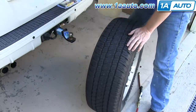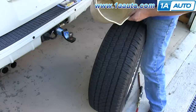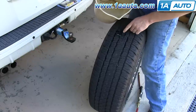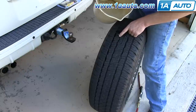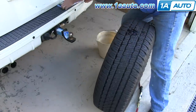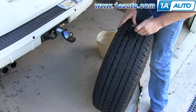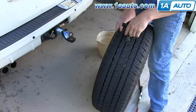If you're not lucky enough to be able to hear the leak, you can use just some water with a little bit of soap in it, and you pour it on the tire. That leak's huge, so it doesn't really work. But if you have a small leak, say we have a smaller leak, you can see that the soapy water will bubble up around the leak, and it'll be easier to find it.